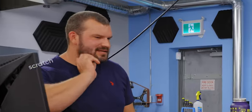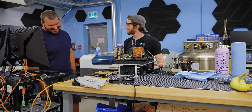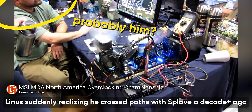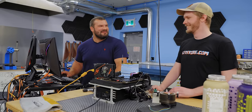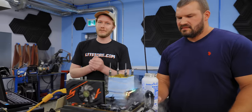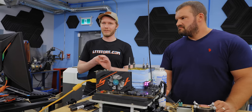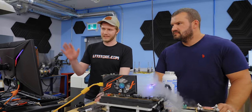Is this one going to do 6.9? I know we can do it — though that's about a whole gigahertz lower than what you've done on these. What I'm really curious about now is just how fast this will go with liquid nitrogen at stock settings — just XMP and the power limit as high as it wants. The highest I've ever seen on an Intel CPU like this air-cooled is about 28,000–29,000 in Cinebench. It only drew 160 watts, even though it was 4.9 GHz all cores. That could be due to the colder temperature — I would normally expect that to be like 300-plus watts.